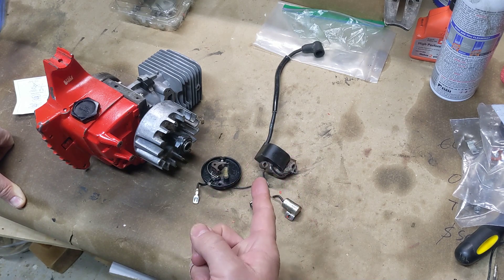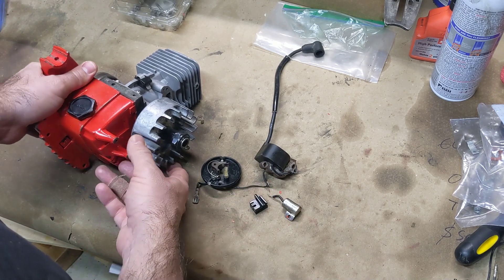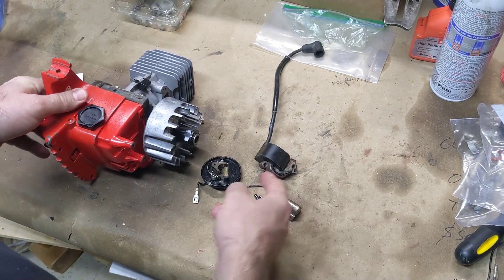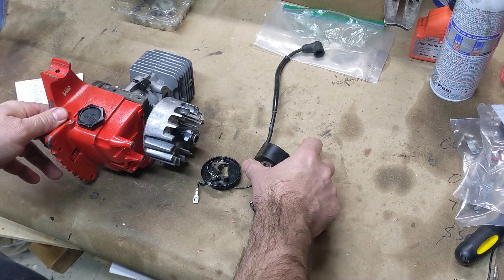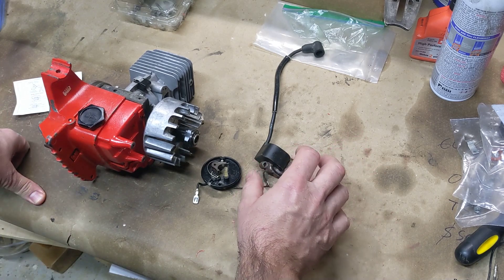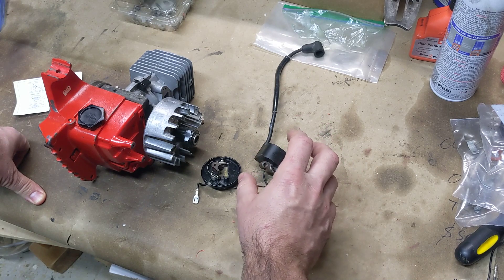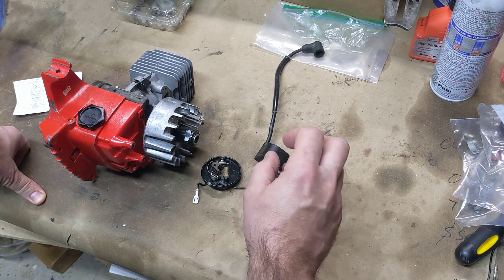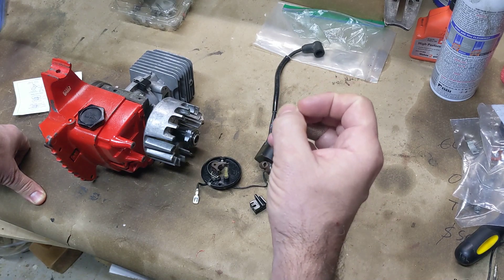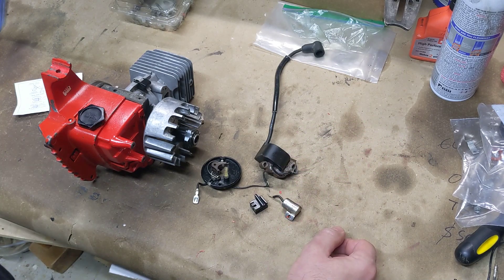The interesting thing about these is we're not powering up the primary side with voltage. Instead, this magneto has two magnets on it, and when those pass by the two close proximity points on this iron core on this coil, it essentially creates a magnetic field that permeates both of those windings. On the primary winding, that's charged with the magnetic field, and so if you collapse that magnetic field once it's charged, it creates the same effect of releasing the energy into the secondary coil. And that's how you get your spark.